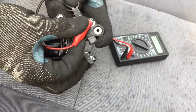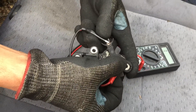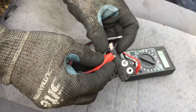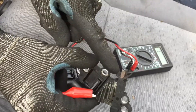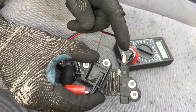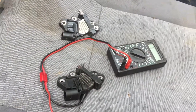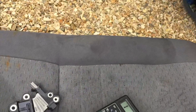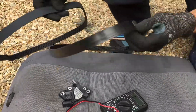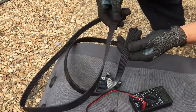When I was pushing it earlier, sometimes it kind of made a short connection which just indicates something is happening here, but usually the brushes just wear out and go very short. As you can see, those brushes look okay but they're not okay. I hope that's helpful. Also when you do this job, I would recommend you change the belt at the same time — the belt costs about 8 pounds or euros and it's definitely worth changing at the same time.